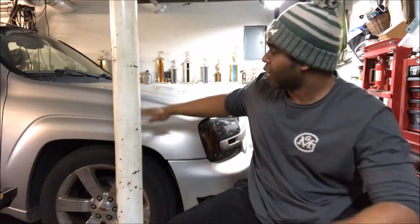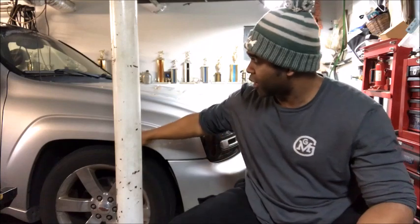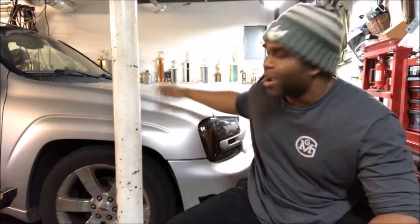So now, if you remember, the kit comes with 8 and 16 millimeter shims, and when I installed it, I installed 16 millimeter shims all around. So I went back in, took out the shock, and installed the 8 millimeter on the passenger side. Now the passenger side is at 30 3/4, and the driver's side is just a little touch over 30 3/4, which is good because by the time I put my 225-pound buttocks in the driver's seat, it levels out nice and even. And that's what you want. You want a nice and even level car.